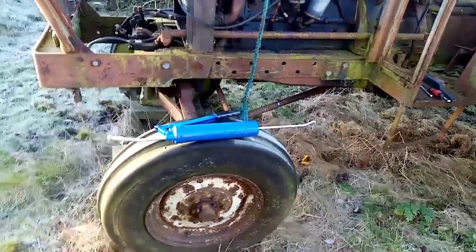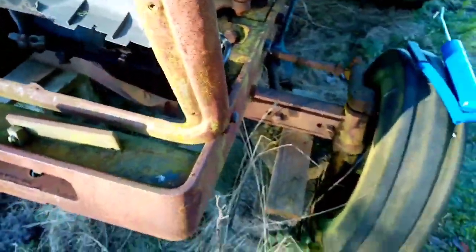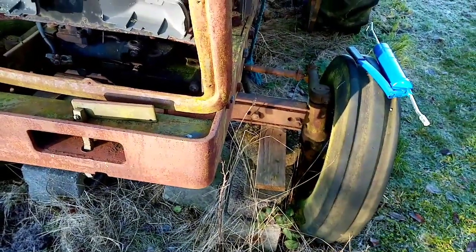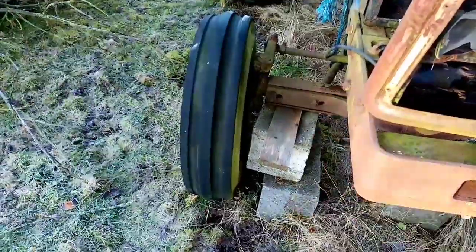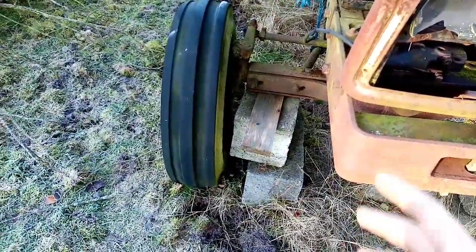It's not obviously moving, but that's fine. The front end hasn't ever been greased properly — these front stub axles were seized when we got it. We only got it freed out about last year, so there's stuff in it, but I'd rather just get the proper grease in where it should be.